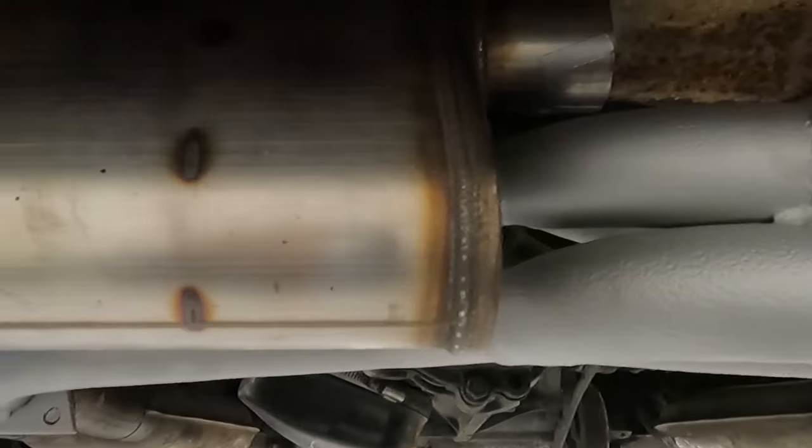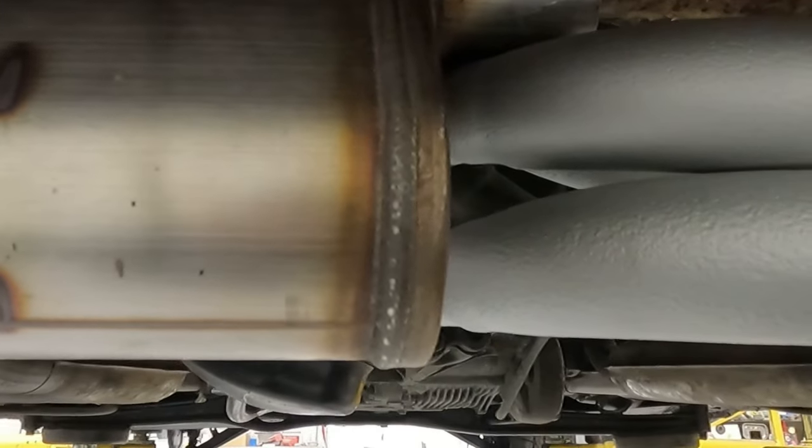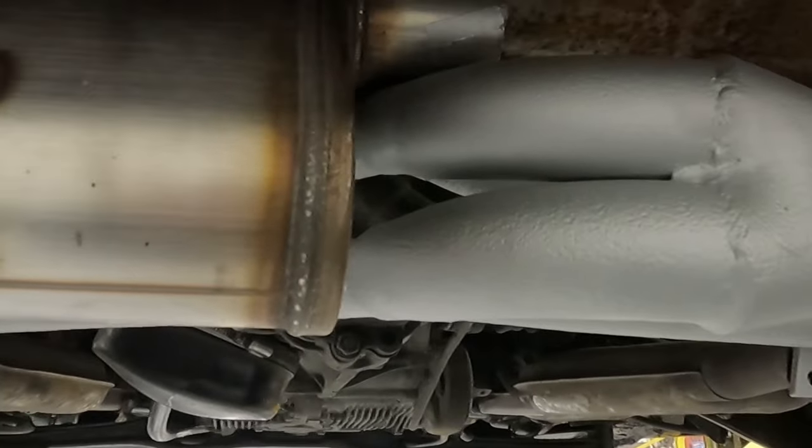So that will be there. So we got that pipe there, and it's too high. You can see up there. So I got to take like 3 inches out of that. And when I get the muffler in here, it's got to go up above that. So we need to take out a lot. I'm okay if that sits right in there. And then we'll have to trim that back because that looks goofy. I kind of want it to come out just underneath this little bump out here, right here. Almost immediately when it comes out, I want it to turn. So we'll trim that, see how much we got to take out of that, trim that back, and see where this sits after that. Let's go over to the bench and do that.